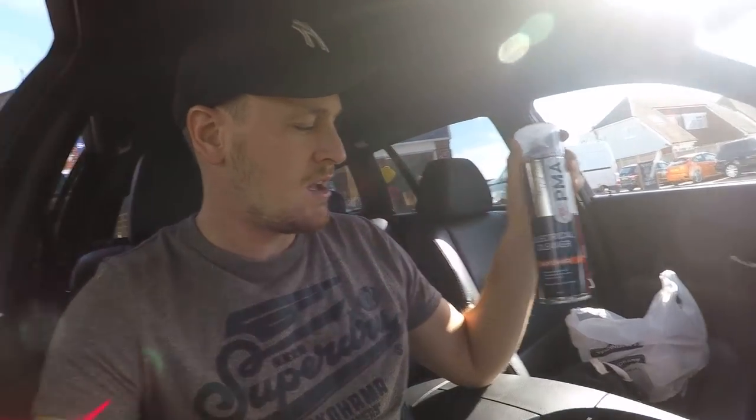Guys, how are we all doing? Today I've just quickly gone to the motor shop, so obviously for more MR2 stuff I've had to get some electrical cleaner, because the plug which goes to the speed sensor on the gearbox is covered where the water's leaked into it, because someone hasn't put the plug wires back in, and the little rubber grommets going in, someone hasn't put them back in, so I need to clean up the contacts. I'm hoping that will help.